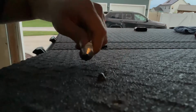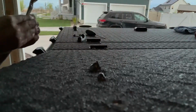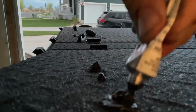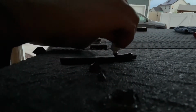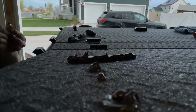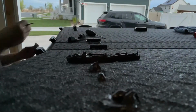All right, next step here, you're gonna use the Loctite. They give you a ton of Loctite. So I accidentally drilled 3 holes, so I filled in that middle one with a bunch of Loctite. However, for the rest, you'll just do kind of a circle, and then they gave me so much. You'll see here in a second, I literally put it all over the pad as well. Honestly, why not? If you've got enough, let's just make it so there's no chance of this leaking. Even though, some feedback for the Diamondback HD covers is that they leak quite a bit either way.